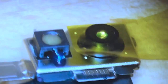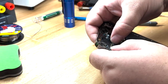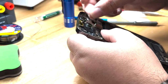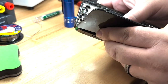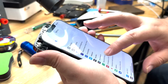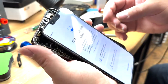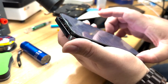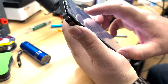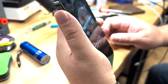We'll go ahead and install it back in the phone and test it. We'll get all the flex cables connected up, get everything connected, and peel off the little protectors for the cameras. Grab the display and connect it up along with the proximity sensor, plug in the battery connector, and turn this on. Now let's go set up Face ID — and there it goes. And as you can see, if I tap the phone now — that would typically have killed it — let's even set the screen inside the phone a bit and set it up again, and there it goes just like that.